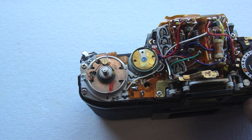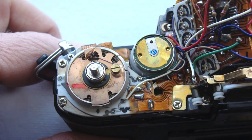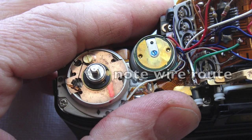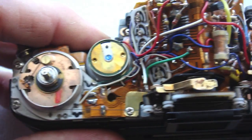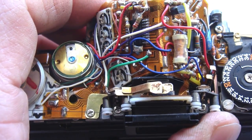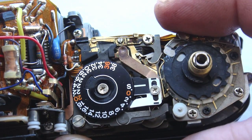Now it's possible that the tungsten wire lost spring tension. If that's the case, we will need to set the spring tension on the resistor plate dial. Note the position of the wire around the adjustment eccentric as you route the wire counterclockwise around the spring tensioning. Holding the tension on the tungsten meter wire, route it through the pulleys as shown. Then install the meter link plate as previously demonstrated.